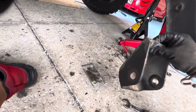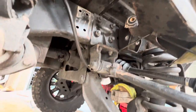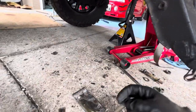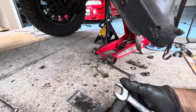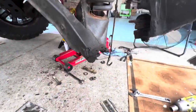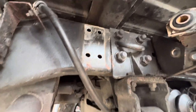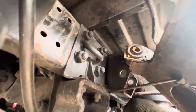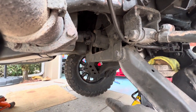There's no way to slide the second shim off without getting the whole bracket off. To remove the bracket it's 19-millimeter, four bolts and nuts with washers on both sides — same as three-quarter inch, use whatever you have. You've got to get in there with a power impact or whatever you can. It's a lot of back and forth with crap falling in your face, but we finally got it off. Now I've got to do the passenger side the same way.